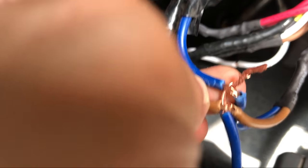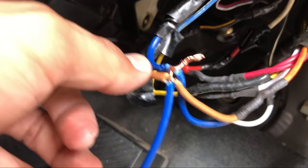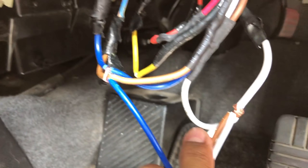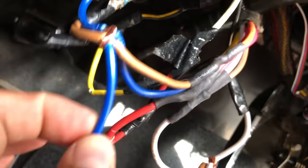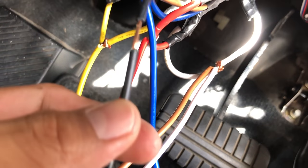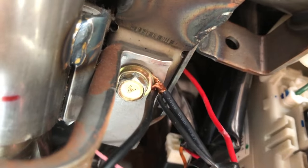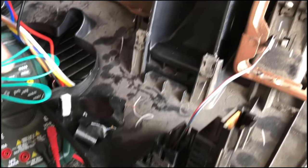Now, the system has one accessory wire. If your car has two accessory wires, connect them together and join them to the blue accessory wire from the kit. If you have two 12V constant wires, connect the red wire from the kit to both of them. Remember the holes we created earlier? I went ahead and connected the one accessory wire from the kit to my two accessory wires, just like a needle and a thread. Next, we have the ignition wires — I twisted both of mine together and connected them to the single on wire from my car. Then we join the start wires together. Last is the ground wire — best practice is to use an existing factory bolt in your driver's side kick panel. Since we're just testing right now, I've connected the ground wire up here.